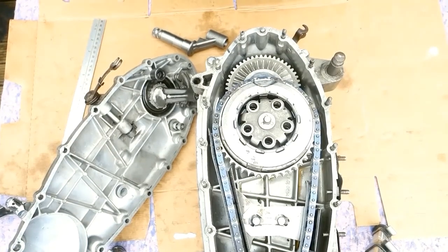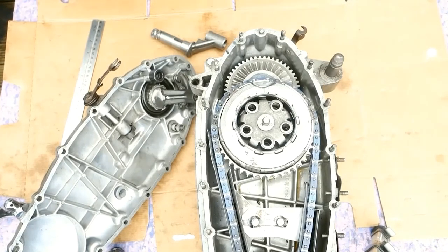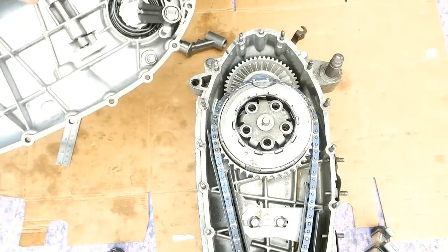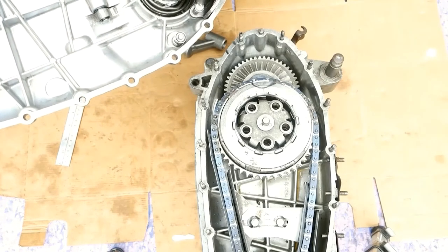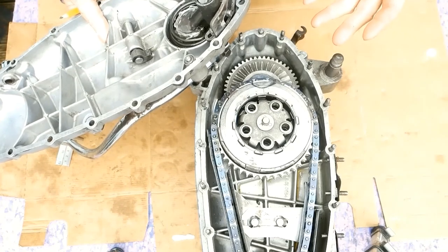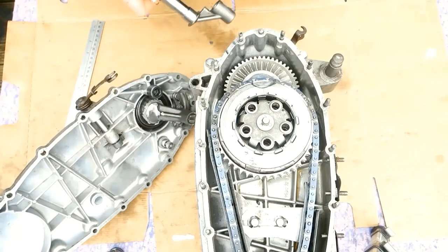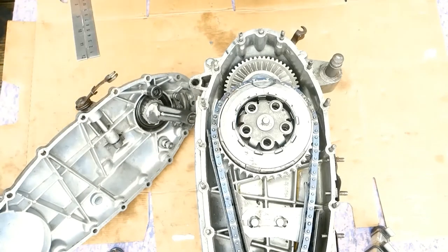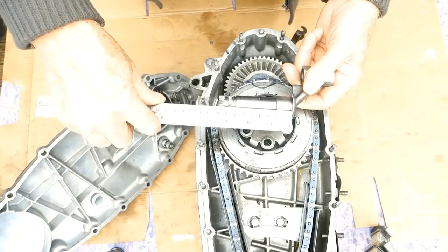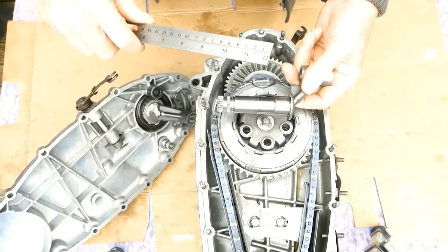A-bar. As mentioned, I've never been happy with the kickstart. With the engine back out, I decided to have a good look at it. Couldn't find the issue and went down the comparison route. My general understanding improved, but I still couldn't figure out what the issue was. No matter how I put it together, the teeth always protruded at least 3mm above the top of the shaft. I couldn't get the pin to locate, or the kickstart to properly locate either. Considered it might be the splines and ordered a new shaft — it's a GP shaft. The rider said it measures 66.5, which it does — closer in length to an early model shaft than a GP shaft. It did not provide the answer.